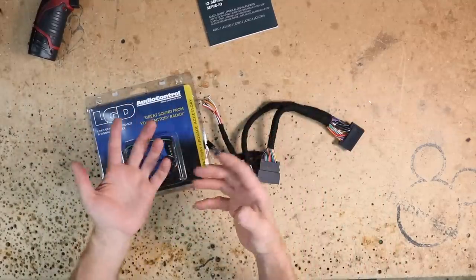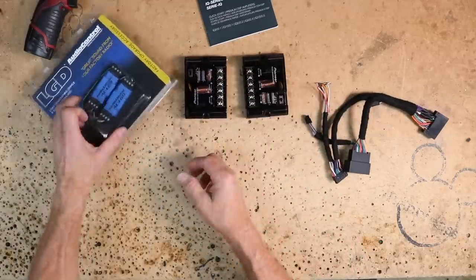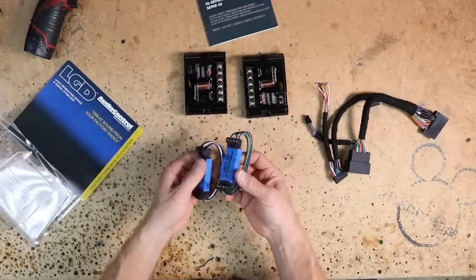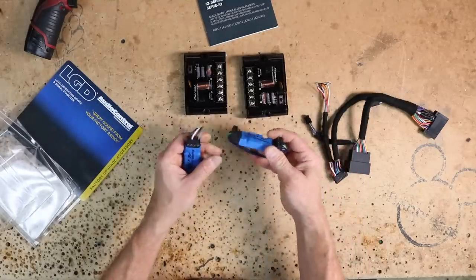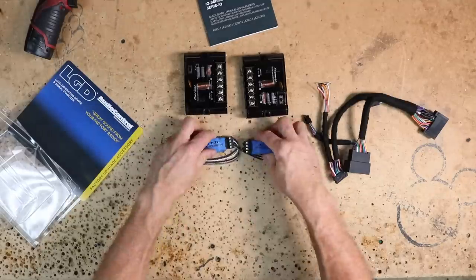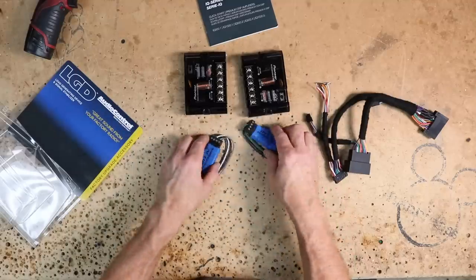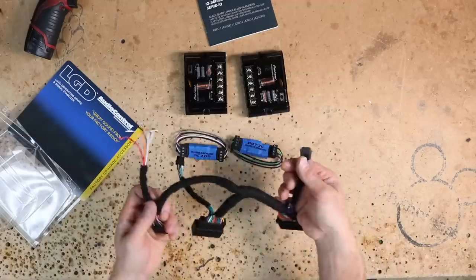Next, we want to figure out how all this stuff is going to get installed into the car — that means more bench time. Behind that Ford radio, the screen is small and doesn't take up a lot of space, so there's a giant gap behind there. What I like to do is make a panel that mounts a lot of the things there. In this case we're doing a set of components in the door, so we have two passive crossovers as well as the two LGDs. This stuff can all go back by the amplifier — it doesn't have to go into the dash. These do generate some heat, so you want to mount them somewhere out in the open where they can breathe.